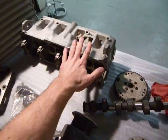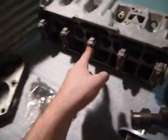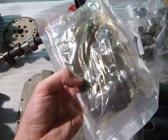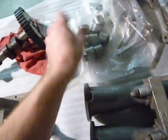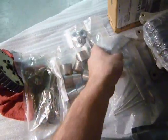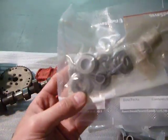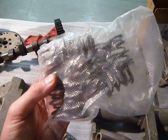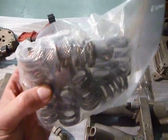This is the cylinder head, which I took apart, and here are the pieces. Here are the ARP unused head bolts. There's the valve train — notice I vacuum sealed everything. There are the titanium spring retainers. Here are the valves that came out of that — these are the Drake ones, heavy-duty big guys. These are heavy-duty springs, brand new as well.